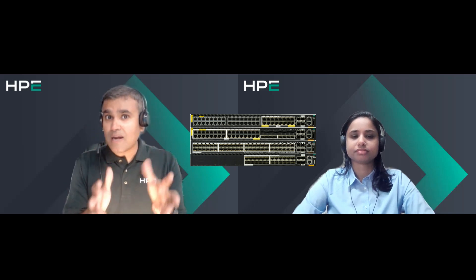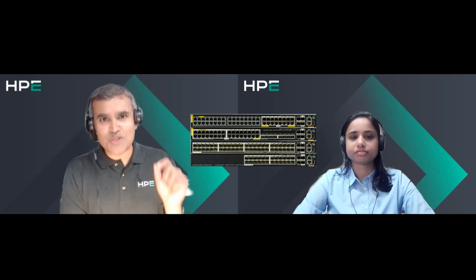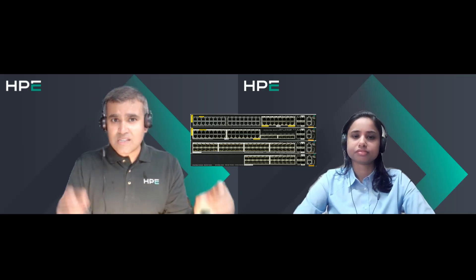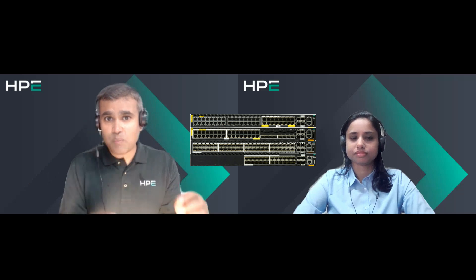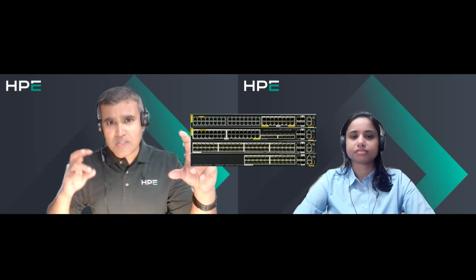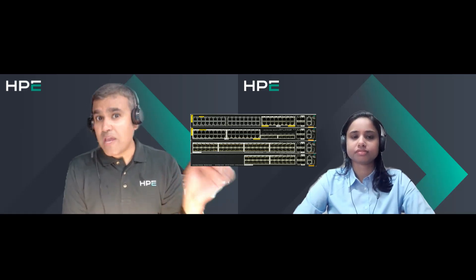Another great addition is smart rate and SFP ports available on these SKUs, where you can directly connect desktops demanding more bandwidth. If you have 6200 stacking, 6100 stacking, or 6000, and you've been waiting for the 6300 family to support VSX — it's coming in the next releases. The 6300 family not only supports industry-first VSF ISSU, they now also support VSX. That means you can deploy your 6200 stack of eight switches and use the 6300 as your aggregation — that's the beauty of 6300 1 gig aggregation.